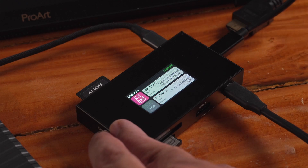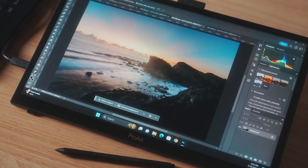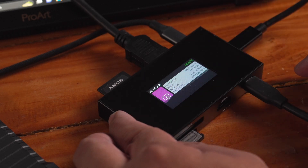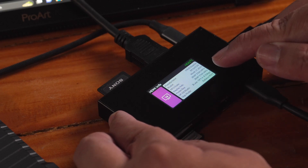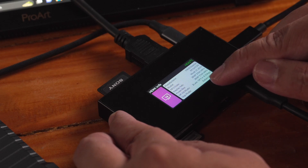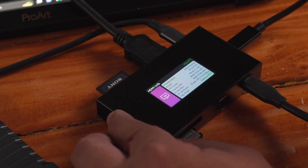The computer has also already read the SSD. Now the last thing we're going to plug in is the HDMI. The display you can see is the ProArt PA169CDV, which is a portable monitor that is also a graphic pen tablet — I'll be reviewing that separately. When we check out the information on screen, it says manufacturer ASUS Display, model PA169CDV, manufactured week 37 of 2023, display info 3840x2160 at 60Hz, preferred resolution, DP alt mode, and chip mode. I've never seen a dock that gives you information on the displays, cards, and drives you're using.